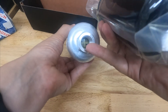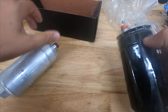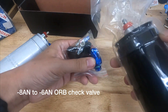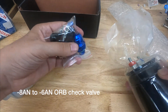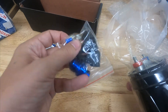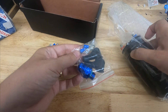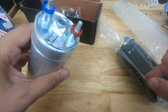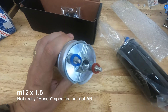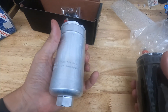The key difference is the bottom hole — the Bosch has a proprietary fitting, while this AEM has a 10 AN ORB port and comes with an ORB fitting for 8 AN to go in there. It also comes with wiring, which the Bosch also came with and I've already wired to the car, so this will be an easy swap for me. The Bosch comes with a Bosch-specific hole that requires a Bosch-specific adapter — another inconvenience.